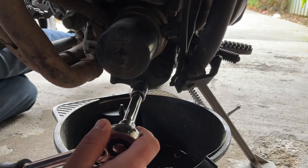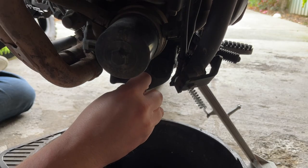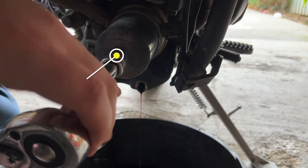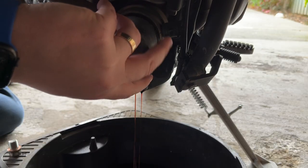Stop the bike and then struggle with the sump plug. You're going to need an oil drain pan, and on my bike I need to take off the Outback Motortek skid plate to access the sump plug and the oil filter. This is a 17mm socket, and I use the high-flow oil filter which has a 17mm socket on the end of it as well. I don't use the socket to do the filter up, but it's great for getting the filter off.